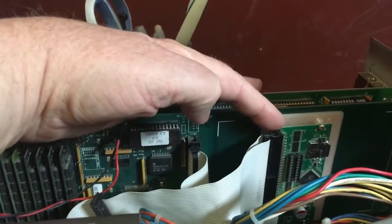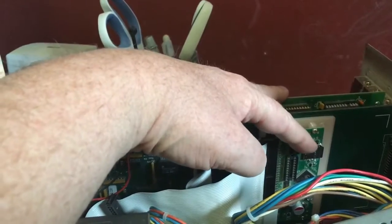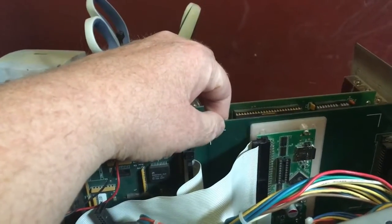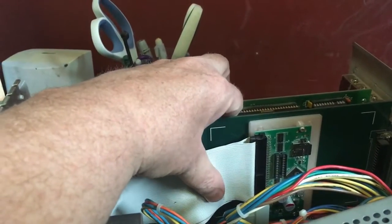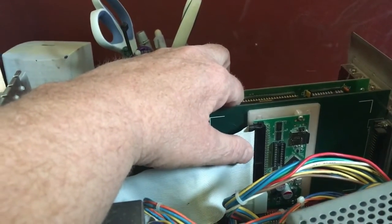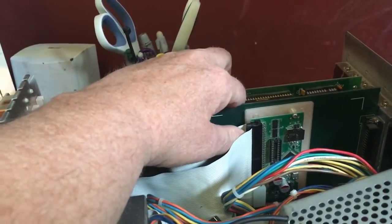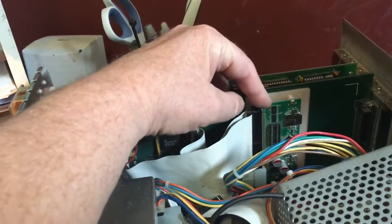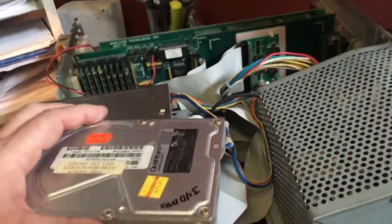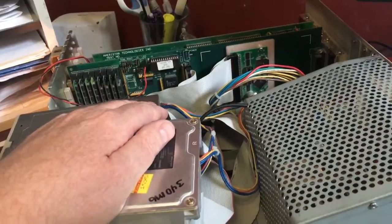And basically what you do is you take this card with whatever hard drive you want in there, air quotes, and you take it over to your laptop and plug in a USB cable, and you put some low-level information on there, so to make it look like a SCSI device. You tell it, is it SCSI device 1 or 2 or whatever. I made this one SCSI device 1 because this one was 0. The idea is I boot them both and then copy all the information over, and we're good to go.